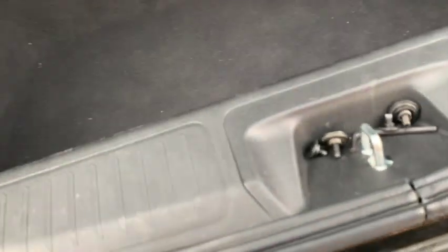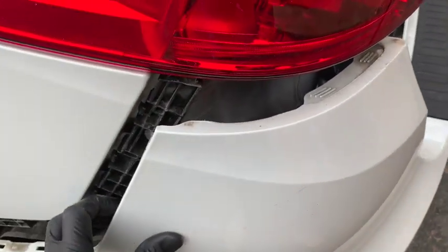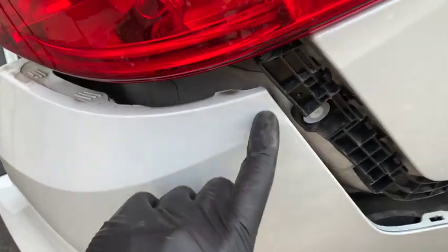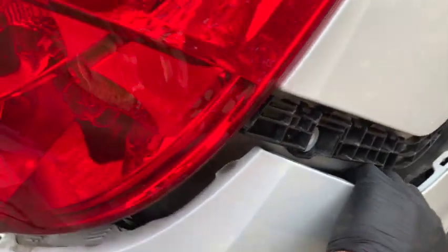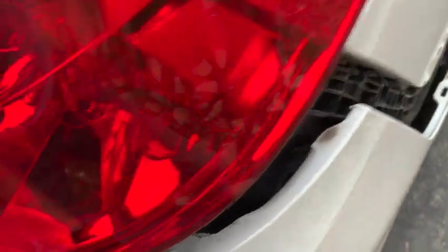Then we're going to get back on our feet to fit the rest of the bumper. We're going to go around to each side and make sure the bumper is on the outside of this black spacer right here. This side it's behind it, so we're going to put the bumper on — the spacer is going to stop it from wanting to go onto the car, so we put the bumper on the outside of it. Check this side again and we're good.